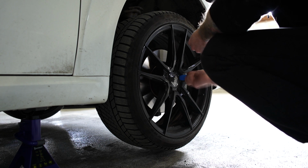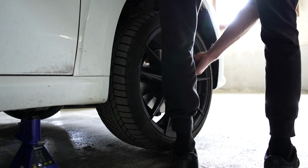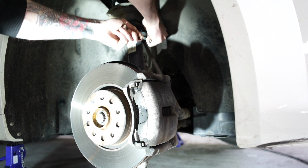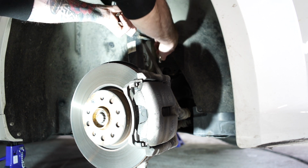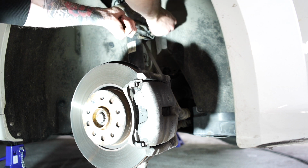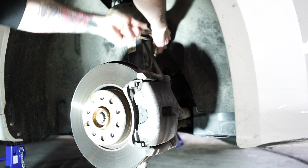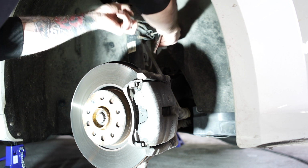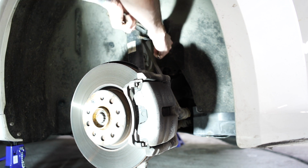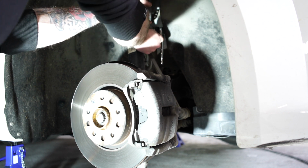Okay, so once I put the car on jack stands, got the front wheel off, I then started to remove the drop link, and after a little bit of fighting with it, I realised that I'd rounded off the triple square that holds the drop link in place while you take the bolt off. It was super rusty. I did spray WD-40 on it the night before, but this right hand wire just was having none of it. The left hand, the driver's side, that came off no problem. So once I realised that, it was sunglasses on, Dremel out and start cutting.